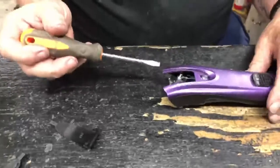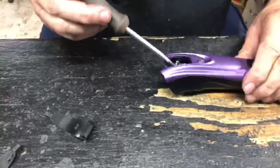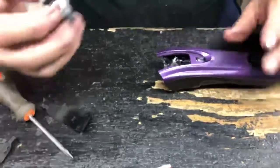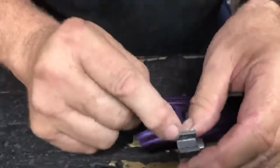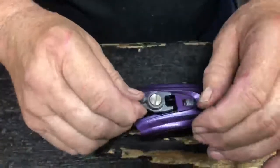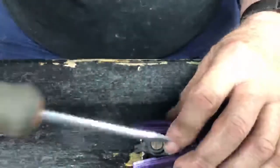It's the only part on this clipper that's really expensive. The switch isn't that expensive, but that's a $30 part, and it's expensive because they know that we're going to strip it out. Get your new lever — make sure there's grease in there. It'll come in a bag. They can be either white or they can be black — there's no difference. It's just a different plastic.